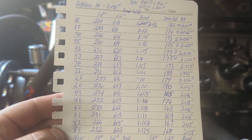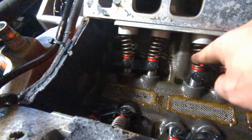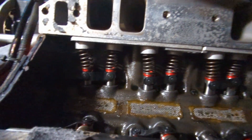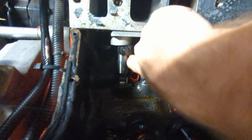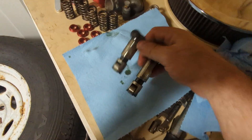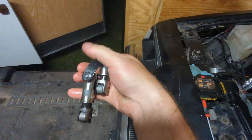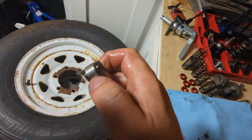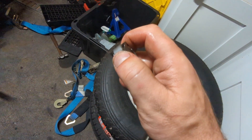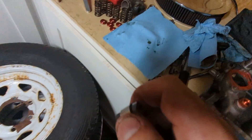It looks pretty clean inside — all my screens are still in place. I pulled the suspect lifter out to check if the roller still has a bushing in it. The lifter goes in that specific orientation and this one would have been the suspect one. It doesn't have any more play than the rest of them — it actually feels like new still. So I probably just didn't set that one correctly with the spring. Surprising, but I guess it's possible.